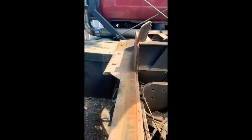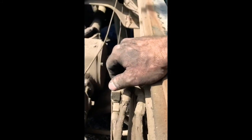So one of these is going to be coming off your foot valve, and another one's going to be supplied air from a tank. Reason being, they want these valves back here because when you get a signal, it's going to allow a larger volume of air to reach these brakes more quickly instead of traveling from all the way back in front of the truck all the way back here to the axle. It's a relay valve. So the same principles, a small amount of air controls a large amount, same with electricity. But if you're trying to trace these lines, I mean, look at that. Disappears up there. It can be difficult. So this is a quick way to do it.